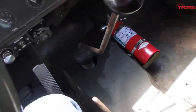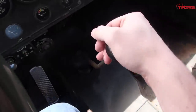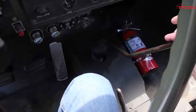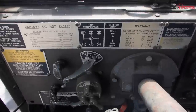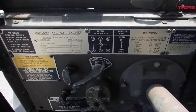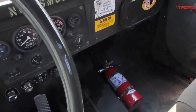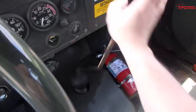It's a five-speed manual. The transmission is a Spicer 3053A synchronized. All the gears are synchronized except first and reverse. It has a strange shift pattern — a dog leg first. Reverse is up and left, first is low left, then two, three, four, five. Three and four, you have to go over the hump to get into four and then straight up into five. So it goes: one, two, three, up and over to four, and straight up to five.